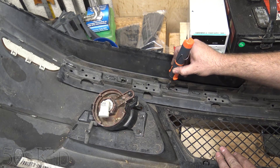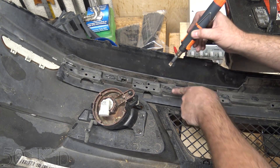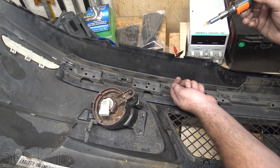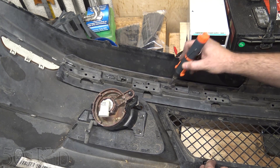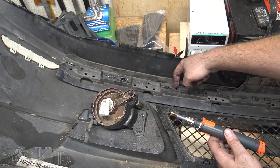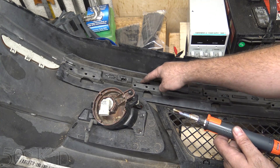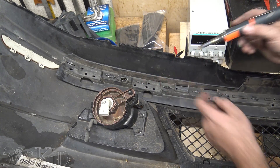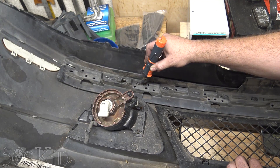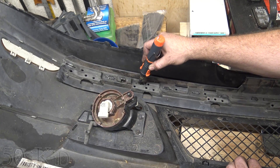See that? It just goes ahead and melts the plastic — that's how this thing gets welded on. I've actually been melting this part of the plastic as well because I don't have as much of the original plastic on this part of the bumper skin as when it was brand new. What I did to make this work is I used a little exacto knife to cut off the little prongs so this would fit back down over it, then I'm just melting this down like this.